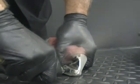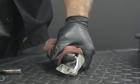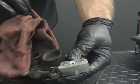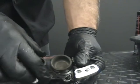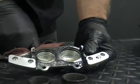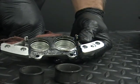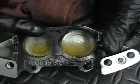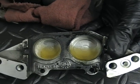Just put it in. You can hear that pop. You saw the fluid come out. And if you look, I'll take the rag off. Almost like a magic trick. Abracadabra, there's the piston. There's the other piston. You can see the fluid in there. That's why you want to wear the safety glasses, because if those pistons blew out of there, you'd be wearing a face full of fluid right now.